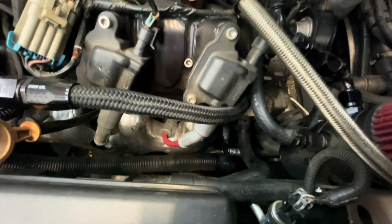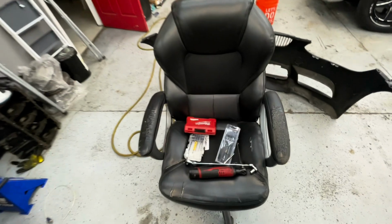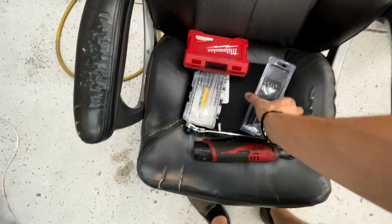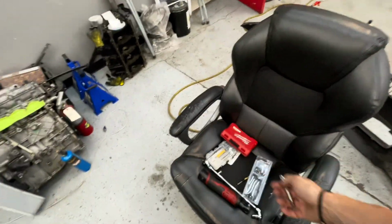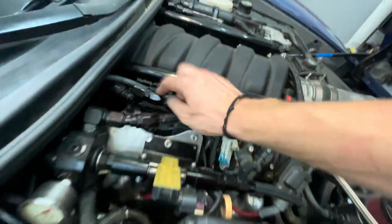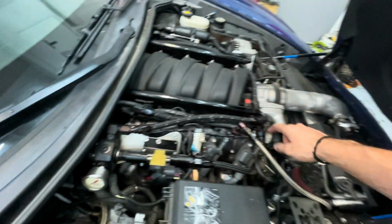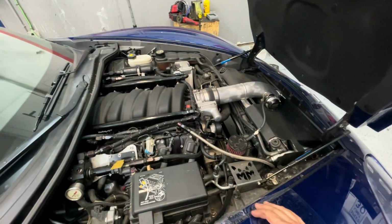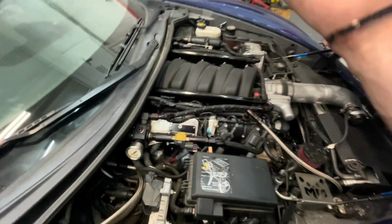So today we are taking it, drilling it out bigger. We bought some Heli-Coils here. Got the tap, Heli-Coils, M8 by 1.25 for the exhaust header. Yeah, we're gonna be doing that. We're gonna be doing some fittings here, maybe later for another catch can. We're gonna get some bigger fittings, run a 2 catch can setup because it's blowing out a lot of smoke or a lot of vent.